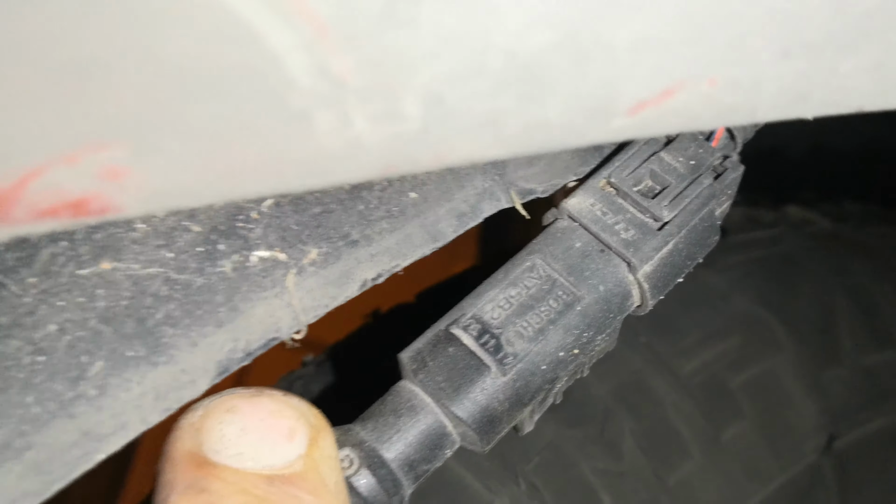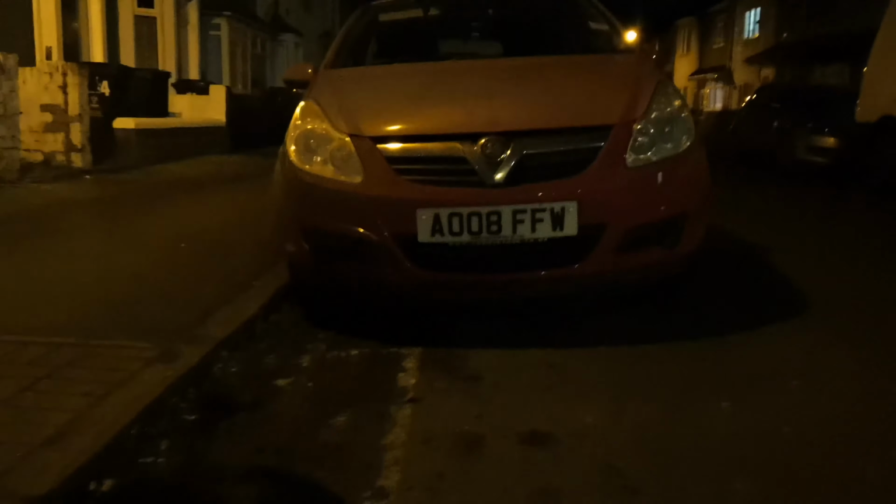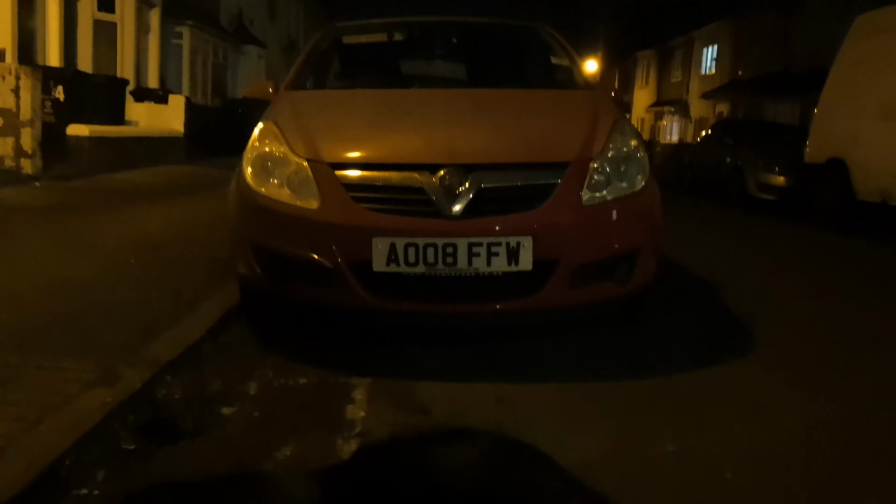The wheel speed sensor has a recurring fault when it's plugged in. When you unplug it, the hard fault goes away. There are a couple of other engine codes which sort of go away as well. There is some minor play at the driver's side front. And that's it. Everything else seems in order, apart from the fact that both rear wheels freewheel way too freely and the handbrake needs adjusting.